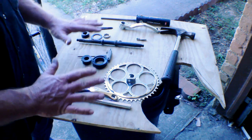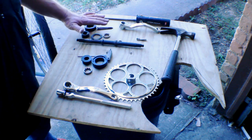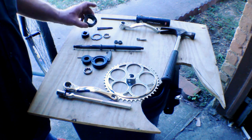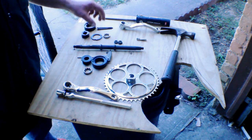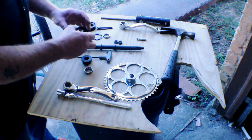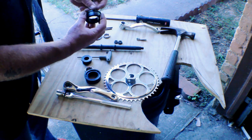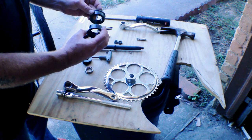We're ready to install our crank assembly here. This is going to go on the left hand side of the bike. We have our bearing plug which is going to push into the bottom bracket where the bearings are. This is going to go in first. We're then going to put this other bearing plug — the one that has the holes where your allen screws screw into — so your allen screw will go through the bearing plug on one side and then screw into the bearing plug on the other side.